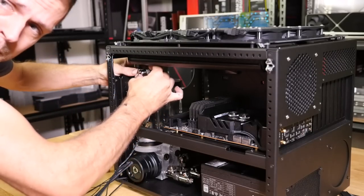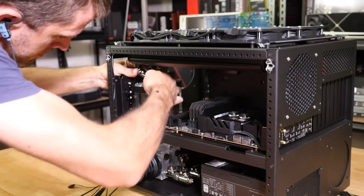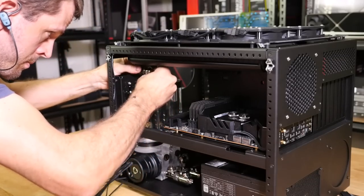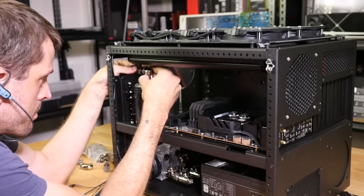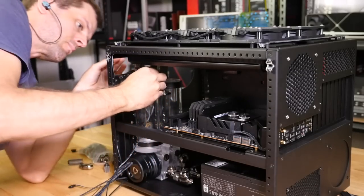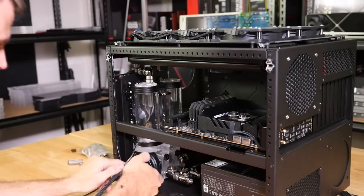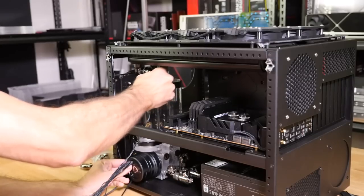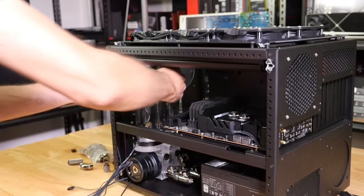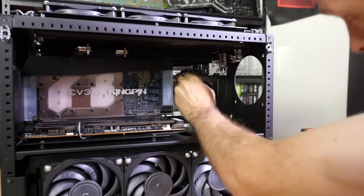And you can see that this was a secondhand case, obviously. Somebody had already modified it and added those two portholes. I only ended up using one of those portholes, but there's definitely some mods that need to be done. And similar with other Caselabs cases, I used to always modify the reservoir mounting areas on the SMA8 and the STH10, and also modify the dividing panels on the SMA8 and the STH10, to get the loop up and down into the upper and lower compartments. Quite a lot of mods are required if you actually want to do a clean loop. And I mean cutting and drilling the cases. I know a lot of people are trying to avoid cutting and drilling these cases because they're really highly sought after collector's items now. But if you want to avoid that, you're going to be doing some extremely long runs with the loops. And yeah, it's going to be a messy build.